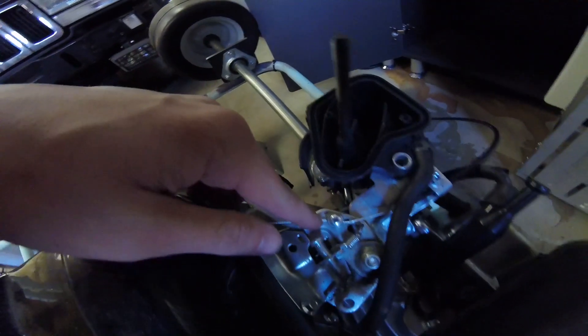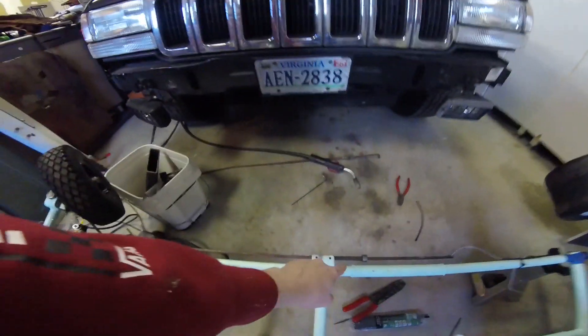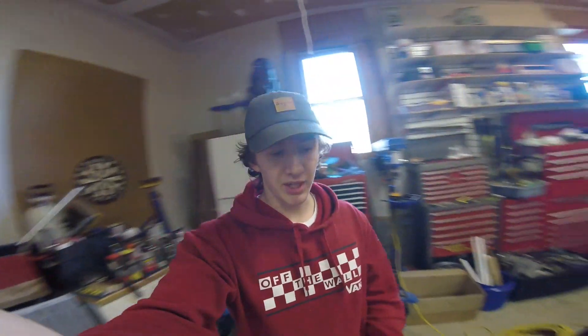I just put the bicycle cable on and now it's all hooked up. You screw in the wire here, and this holds down the rubber piece so the line can go freely through it. When you push the pedal, the spring pulls it back, the wire pulls on the throttle, and every time I push the pedal, the throttle moves. There's already a spring on the throttle so it goes back on its own. We're not going to start it today — no brakes, and I don't even have a seat. We might be able to get one today, and if so, next video we'll probably be able to start it. We're going to head to the go-kart and Jeep bumper place.